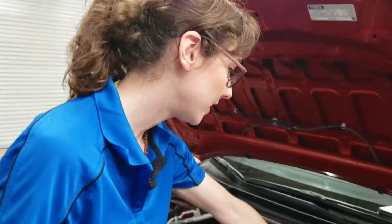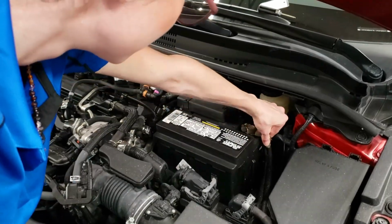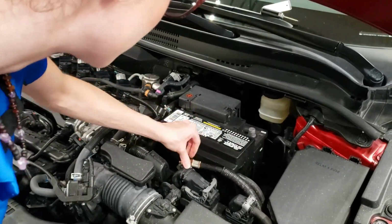So what I'm going to be doing here is going along the wiring line, looking for any issues. Maybe something got unplugged or bumped when somebody was cleaning. So I'm going to be going and looking for that. But the first thing that I'm going to do is take the 12-volt battery off so that we don't have any safety concerns. So we're going to be disconnecting the battery, and we're going to be using a 10mm socket. I'm just going to be setting that in a place where I don't think it can pop back up and touch the terminal.